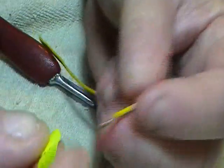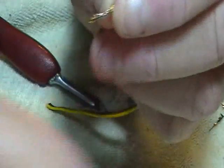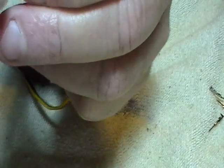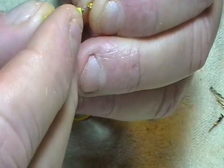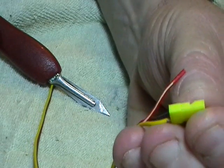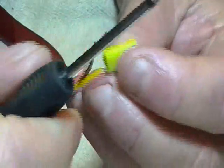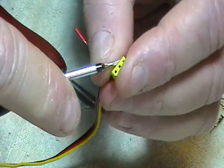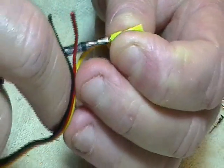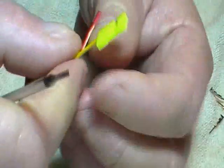When you go to put the pin in the tip, remember the light color goes to the left side on the female end. These generally go together simply and don't twist up on you. It can be hard to get them pushed all the way in, so I use a tiny flathead screwdriver — I mean tiny — and you can get a hold of it and feed it up a little ways, or get in behind it and push against the metal. Be careful not to stab yourself — it hurts.